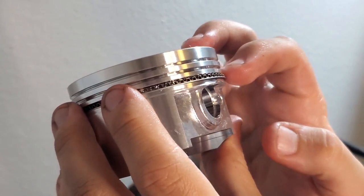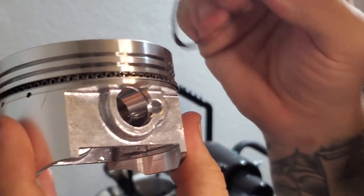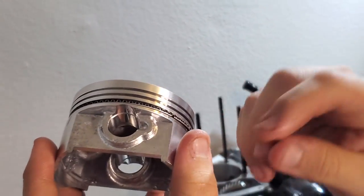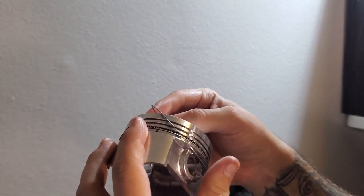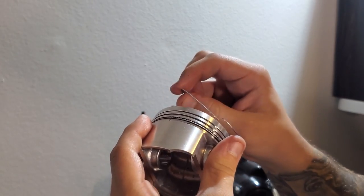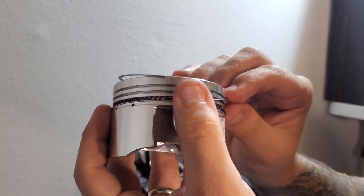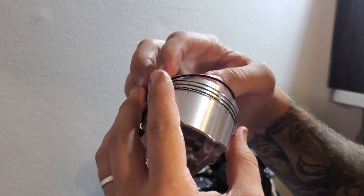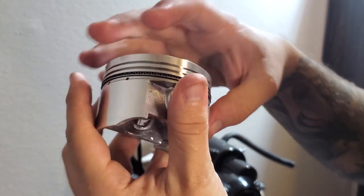We have this squiggly oil ring and the bottom one inside. Now you need one on top of the oil ring right here. We're going to offset it slightly — you see where this little break is in the ring — offset it so there's even distribution, making it so that oil cannot get to the top. Be very gentle, as these don't have enough pliability to actually bend the hardware. Sink it down just like that.